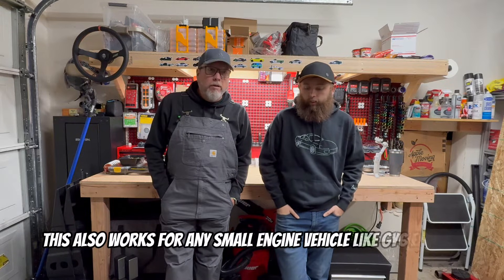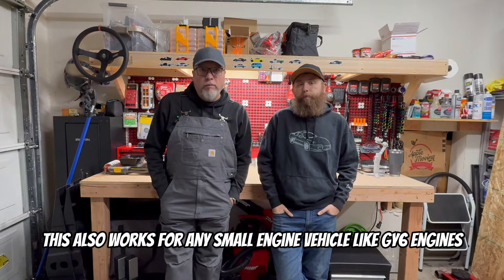Hello, welcome back to RevRender Garage. Today we're diving into a very common problem on any small engine vehicle, especially these Mad Dogs, and that is a vacuum fuel pump. The most common issue is losing vacuum when you're going up a hill maxed out — you just can't keep up with the fuel your carburetor needs, or after sitting for a while it just loses vacuum completely. We're going to show you how to inexpensively put an electric fuel pump onto your Mad Dog scooter, which will normalize the pressure at all times.